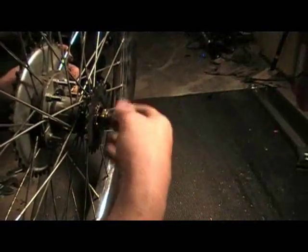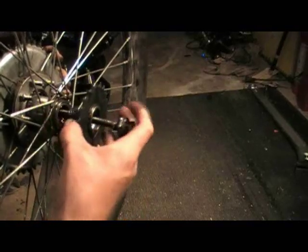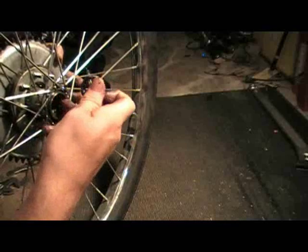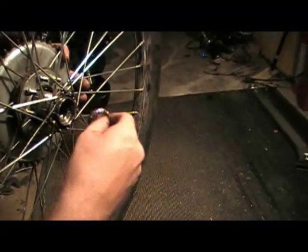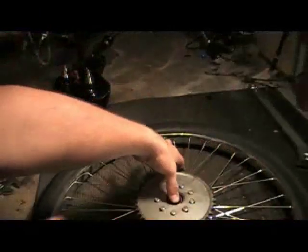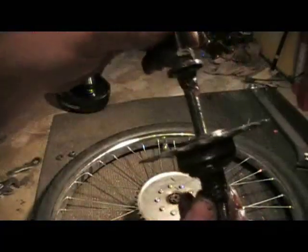When you have it, this will actually unscrew — it has very steep threads. You can pull this out and all your bearings. The wheels will face in to the cup, so they just sit in there like that. You never want to put the collar into the cup because they'll just tear it up. Drop it back down into that hub. Tip this down — my thumb is still in place holding everything down. This side usually you don't really do much with.